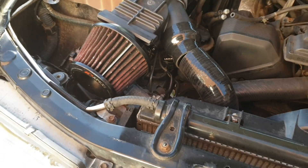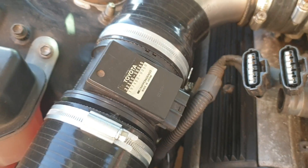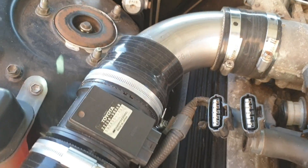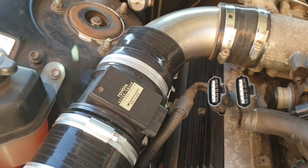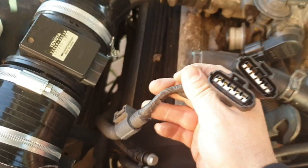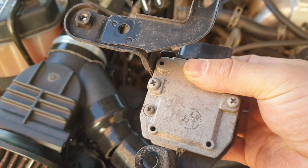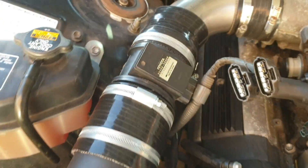This is the intake - I've still got our MAF sensor in there, connected up to there. Managed to get a 60-degree bend to fit in there. I've had to lose the igniters from there - not sure how much - maybe I can get them tucked under there, maybe especially if I take my thick bracket and get creative. Also that bracket there - that's a bend over, but if this works out okay I'll just cut that off.